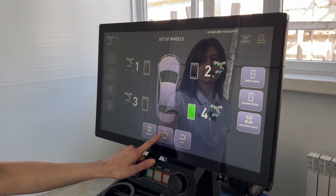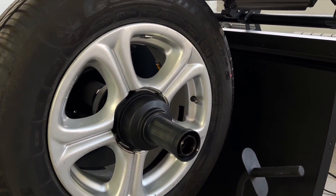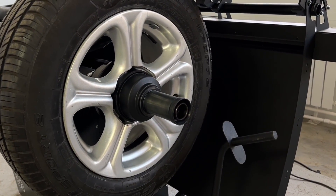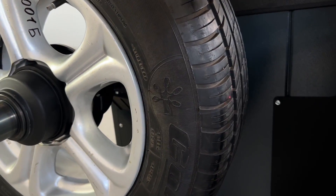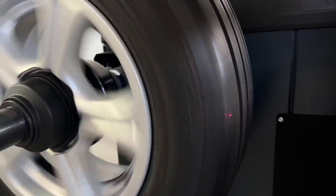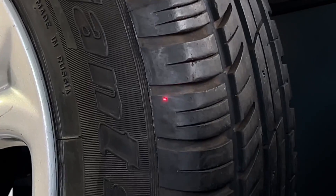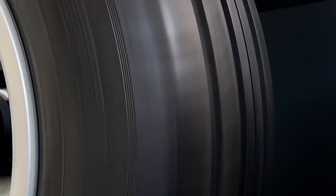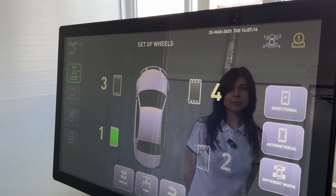Tire Scan technology provides a comprehensive tire evaluation by measuring cone angle caused by uneven tread wear, tread depth and deviations in the tire's outside diameter from the average within a set of wheels. Tire Scan also measures tread depth and determines the tire's suitability for continued use. The machine detects uneven tread wear across all wheels in the set and the cone angle. The machine also provides recommendations for checking wheel alignment settings and for wheel placement on the vehicle to minimize lateral pull.